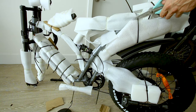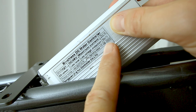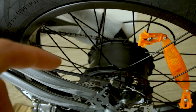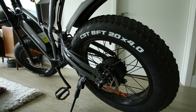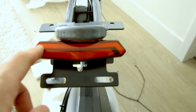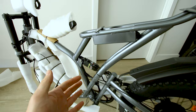The rear shock is a mono shock mounted to a swing arm. You can see the actual controller right here mounted below the seat. 48 volt, maximum current is 25 amps — 48 times 25 is 1200 maximum watts — which will be sent to this rear hub motor. The tail light actually looks pretty fancy, and the gray paint on this bike looks pretty sharp.